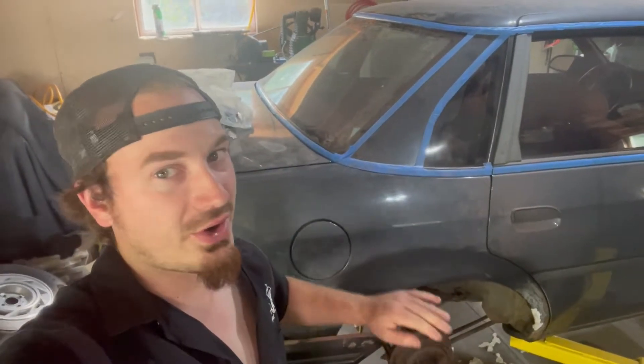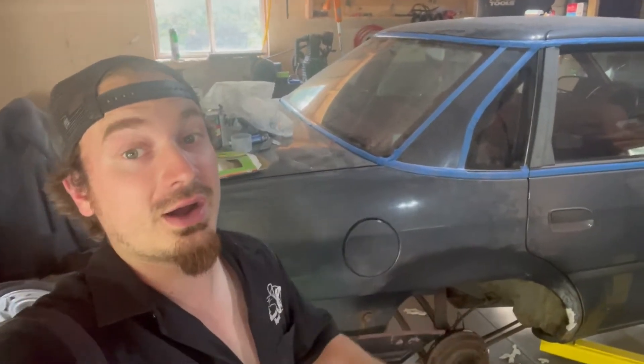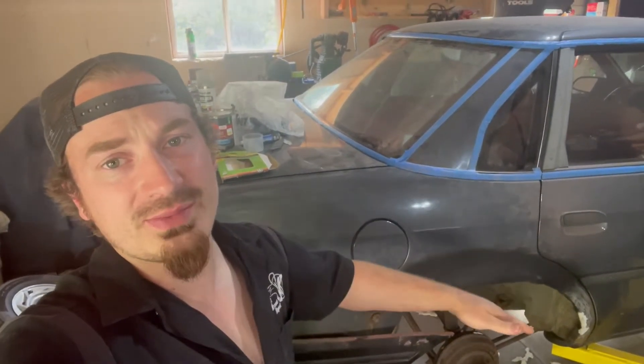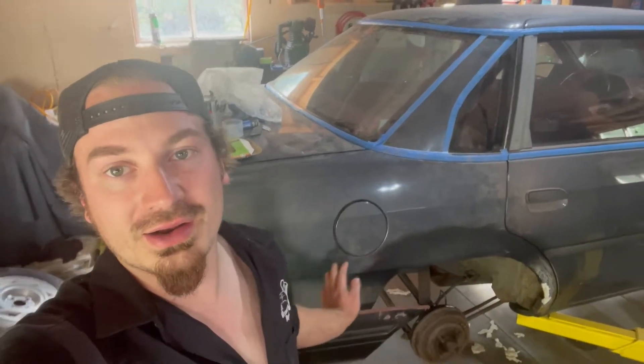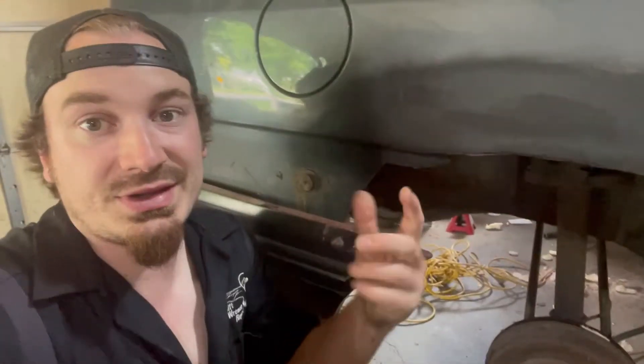There was still metal on the bottom portion, so there was a giant gap. I used that bottom metal as a guide, knocked all the rust out, and then tried something controversial — the expanding foam thing I've seen on YouTube a million times and always wanted to try. This is a $400 car, so I cut out the rust first, giving an even bigger hole, used the expanding foam, then used a little JB Weld on the structural pieces in the corner, and then did body filler over it. Right now I'm just sanding down and getting everything shaped.